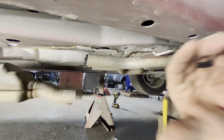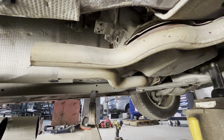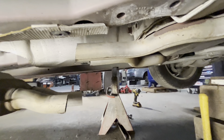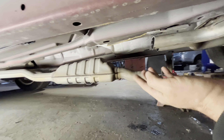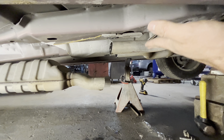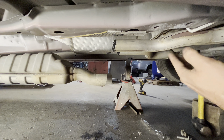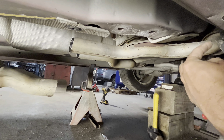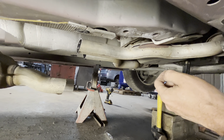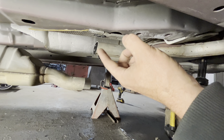If the bolts don't look good, go to the straight sections of your exhaust pipe — we always stagger our cuts so it's a little easier to work with — and cut the exhaust pipe. As you can see, that allows the exhaust system to hang down enough. Then you slide the mount back and it falls right out, because you're not going to get it out without unhooking the exhaust somehow. From age on a lot of these cars, the rusty bolts just break, so the easiest fix is to get some exhaust couplings.